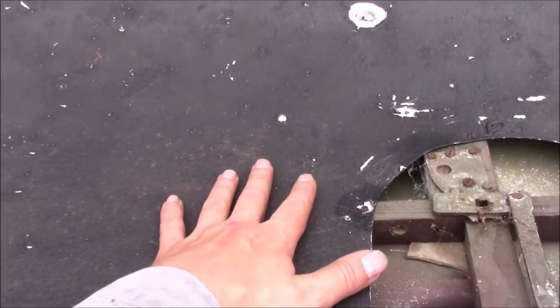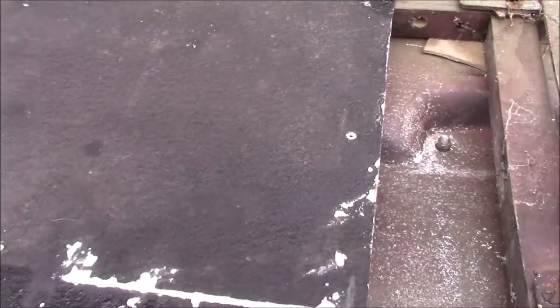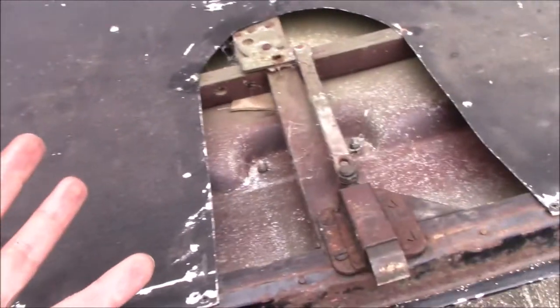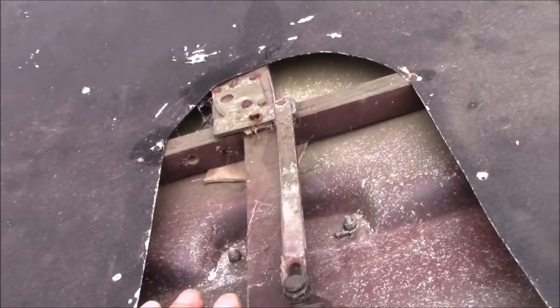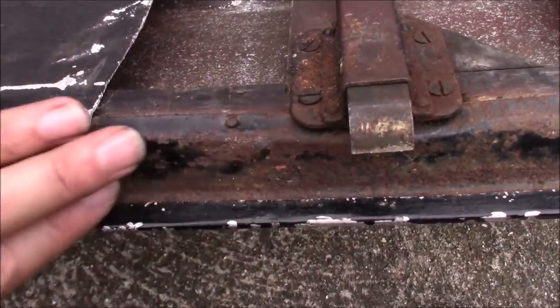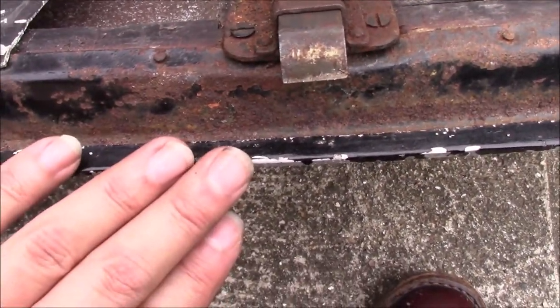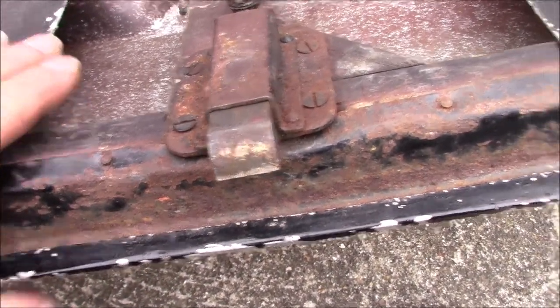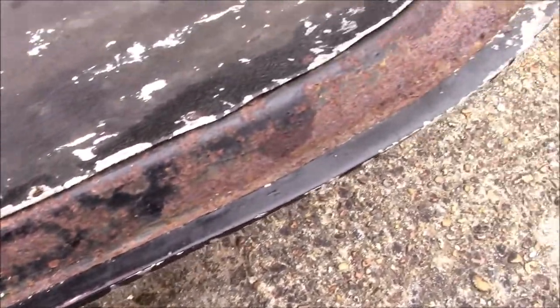The construction's a bit unusual to my eyes. The boot lid is a wooden frame, and then you have a steel rolled edge, and the skin is aluminium. It's almost like a textured truck bed lining finish on it. So there are a lot of places for corrosion and moisture to get stuck, which makes it quite amazing that it's in such reasonable shape.